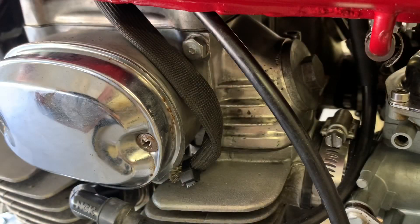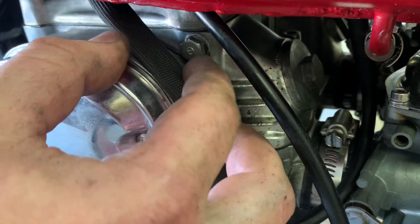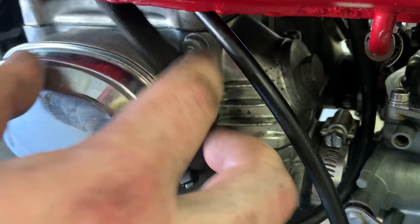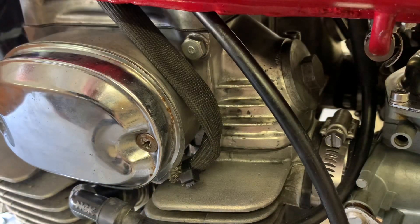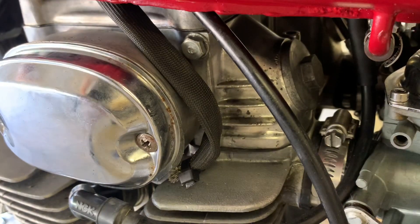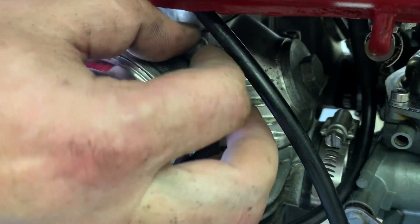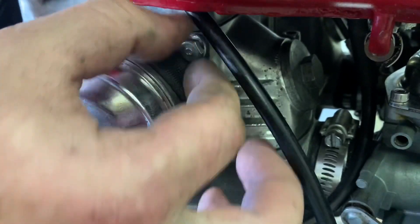Hopefully we see some oil coming out of that port. Here's our bolt — I've got it just loosened up just a little bit. Now what I'm going to do is start the motor and let's see — I'm going to pull it out and then we're going to see if we got engine oil. We should see some splats coming out of that. Fingers crossed. Key on, switch on, gas on. Let's pull it out. Be ready to put it back in really quick.